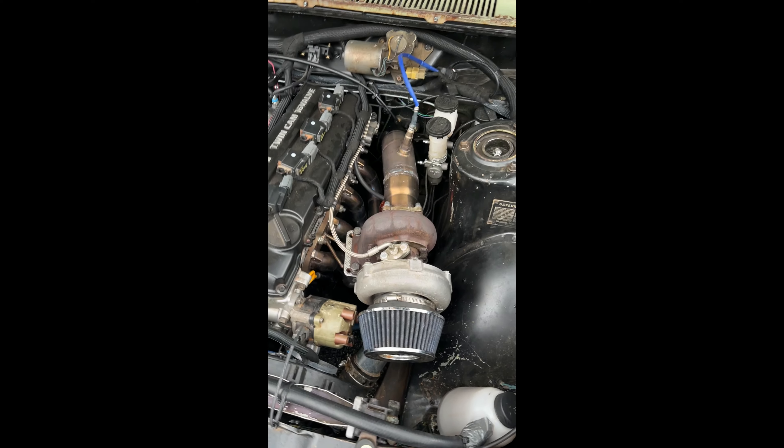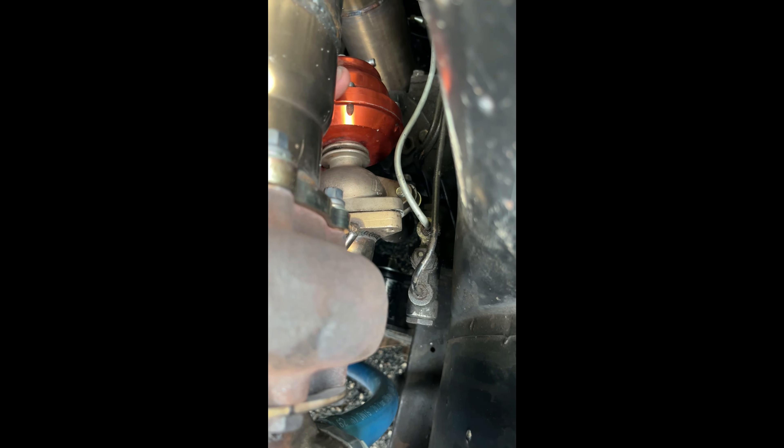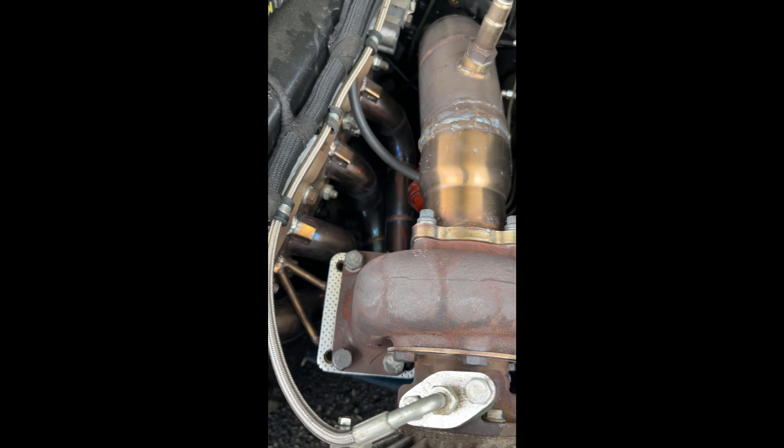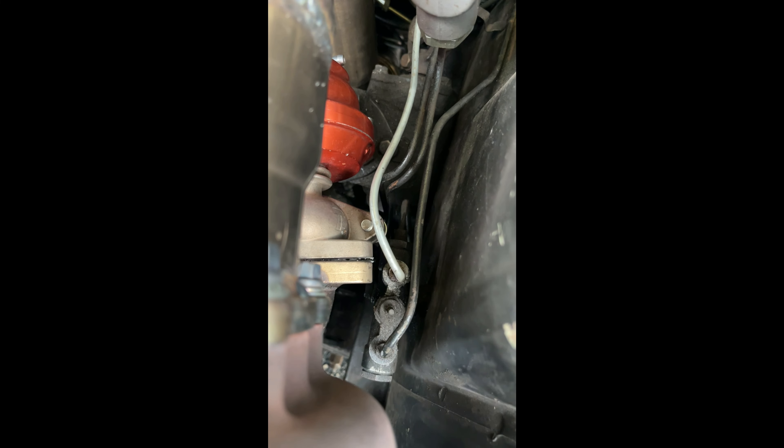Okay, check this out — excuse how sweaty I am, I just got back from the gym. I literally can't make this stuff up. I was working on the Datsun this afternoon, and for the first time since I've owned it, I had no exhaust leaks. I drove it 15 minutes down the road to the gym, and I noticed an exhaust leak develop. If you look right down here — look at that. The bolt fell out of the wastegate. And this bolt right here that I just tightened right before I came — yeah, it's loose again. This one's loose too — finger tight. For the life of me, I cannot get the bolts to stay in this car. So I am going to do something more drastic — I think safety wires are in my future. Well, it looks like that gasket on the wastegate is blown out too. I need a new one of those too. I'll grab some bolts from the hardware store and get home.